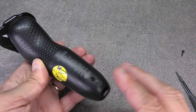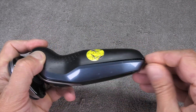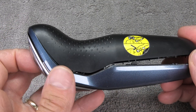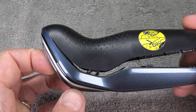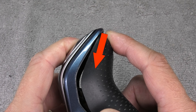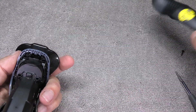When we start to remove the back cover of the shaver we're going to start at the bottom end, because the top end — the very corner — is actually hooked in a specific mechanism. You can remove it on the back end but the top is really stiff. So we have to slide it in a specific direction just to unhook the top end. I'm going to put an arrow here on the screen — that's the direction you want to move the back cover to unhook it safely without breaking any of the plastic tabs inside.